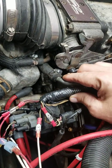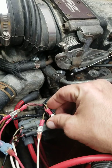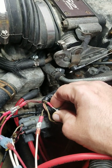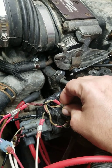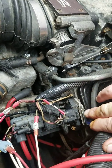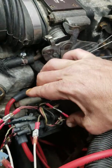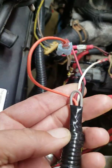From the factory wire harness, I did attempt to use this white wire to see if it would power on the MSD — it does not, it did not work out for me. I spliced them back together. Here's your control module — you still need an OEM control module — and here's your coil from this wire harness.